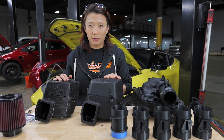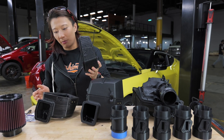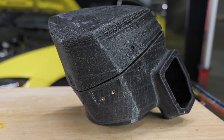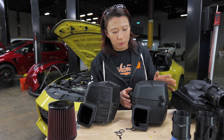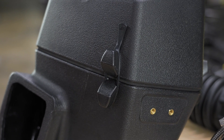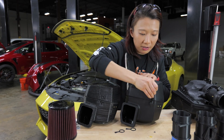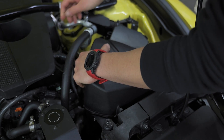The second challenge was figuring out the best way to fasten the two airbox halves together. This is one of our very early prototypes — it used metal buttons, O-rings, and buttons bolted to the airbox. On the final design, we have those clips molded into the box itself, and we also designed a custom O-ring fastener with a pull tab, which lets you quickly fasten and remove the upper part of the intake once it's completely installed in the car.